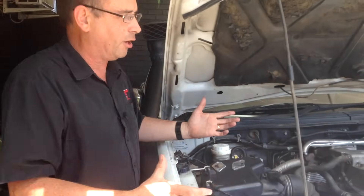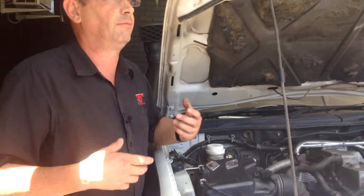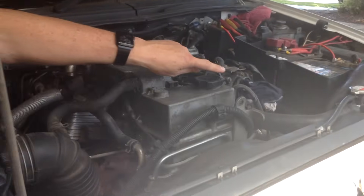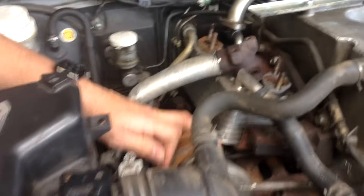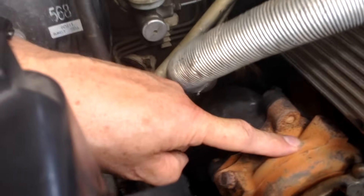This particular car has got everything on it. This client had his engine rebuilt recently and when he put it back together himself, he over-delivered on the things he wanted to do. When the engine runs, the inlet manifold from the intercooler goes through the inlet throttle body, down through the engine, across through the heads, out through the exhaust, through the turbo where it generates energy to run the compressor. Over on the turbo side here, you can see the exhaust manifold and the exhaust turbine. Right down inside here, before the exhaust comes out to the turbo, is a port which is part of the exhaust gas recirculation.